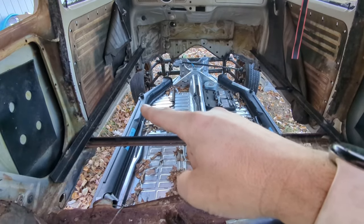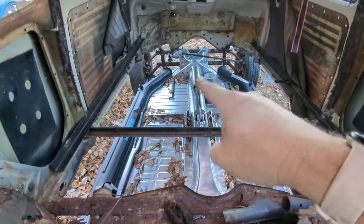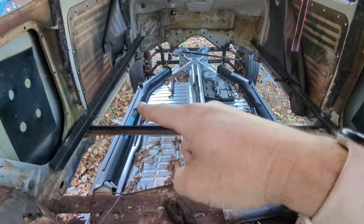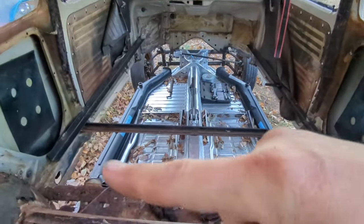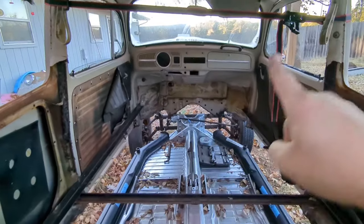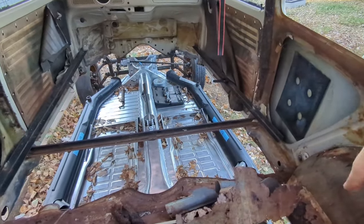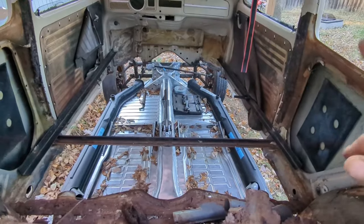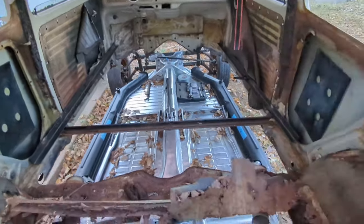And then, of course, the tubes. I don't know if I have the tubes in my hands before I lower this. I've been told you put them in before you lower it, but I've got a trick I've learned that will make this really easy to drop them in, since you don't actually fasten them there. They're just guides. Then the heater channel has that carpet guide, I think is what it's called, under the door. That will be the part that will line up my door for me. And the doors are strapped shut, and there's way too much pinch on them. So once the front's in, I can adjust the back here and here by either pulling the car or pushing the car to get the doors shut correct. Once the doors shut correct, I tack and tack and tack until that's in.